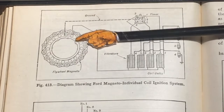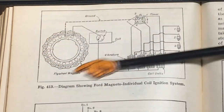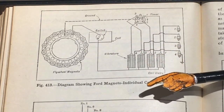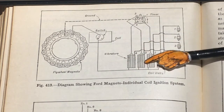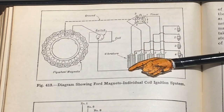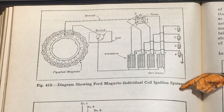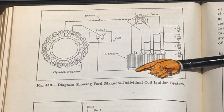Inside: four separate coils — buzz boxes, trembler coils as they call them in Europe — operating pretty much the same way as a doorbell. On the shroud are the coils, wound in series. As the magnets rotate they induce current into the system. The switching on the coil box mounted on the dash gives you the option to select your mode of operation, and supplies low-tension voltage to the primary coil of the buzz box, which induces current into the secondary coil and develops the high tension delivered to the spark plug.